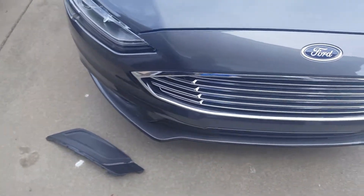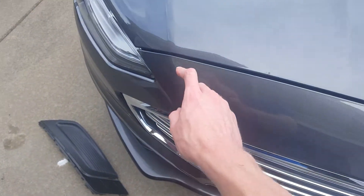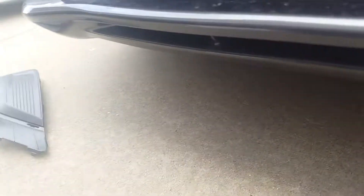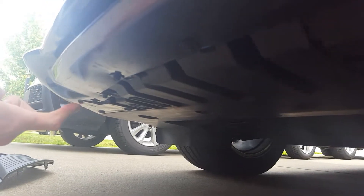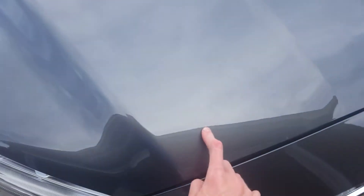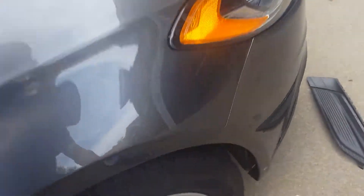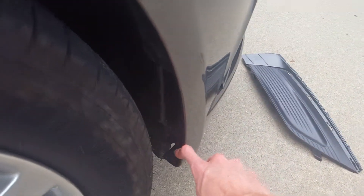I had to take the front bumper off — I do have a video on how to do that. There are screws and clips you have to remove off the top, plus a bunch of screws underneath the bumper. Following the bumper along, I believe they were either seven or six millimeter, and you've got 10 millimeter with some clips up front, and two screws right here.